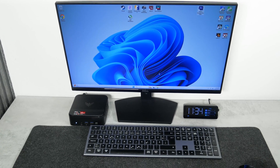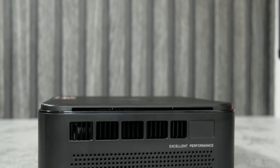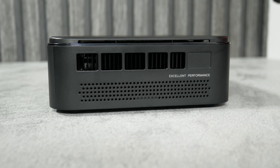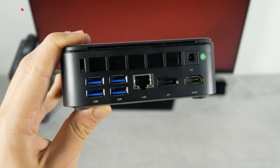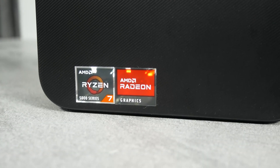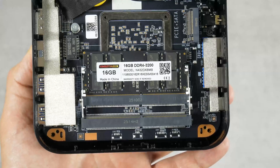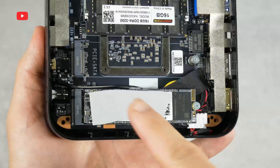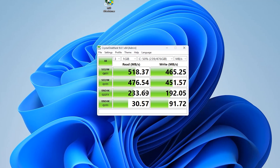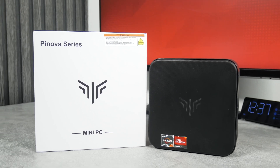To conclude: I like the design and build quality of the CamRui E3B. Yes, it is heavier and larger than other mini PCs, but it has a more effective cooling system. It has many connectors — 6 USB Type-A ports, USB Type-C, HDMI, DisplayPort, and others. The Ryzen 7 5825U really has higher performance than the Ryzen 7 5700U, as seen in benchmarks and games. However, I recommend adding more RAM since 16GB is not enough, and replacing the slow SSD. For under $300, the CamRui E3B is a decent mini computer for home and office.